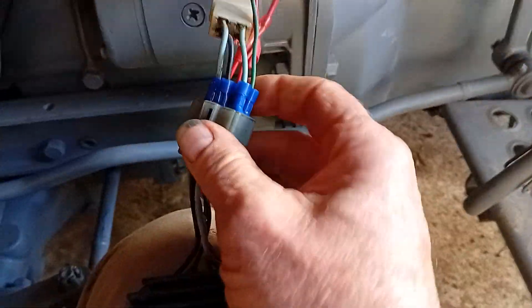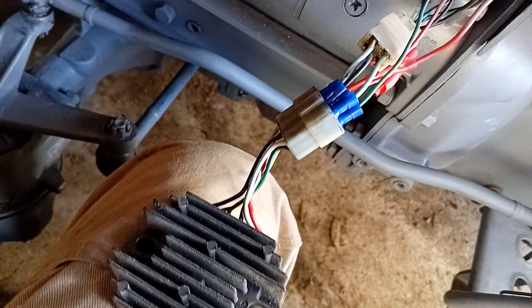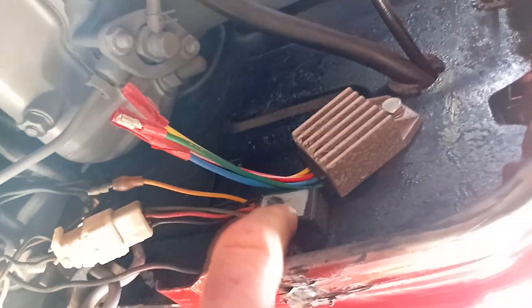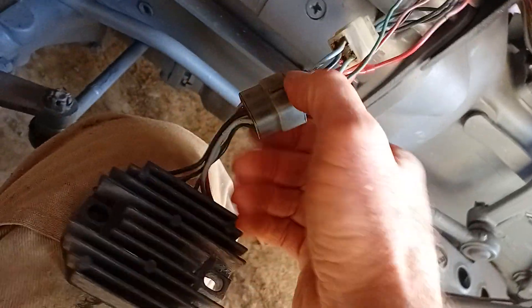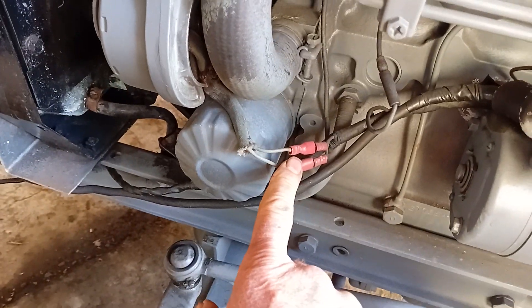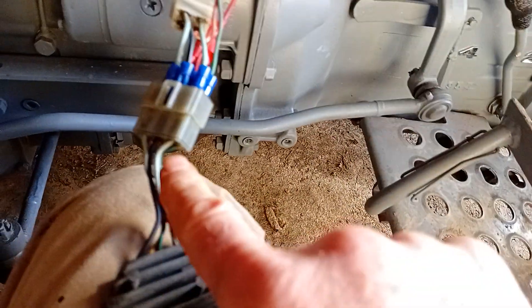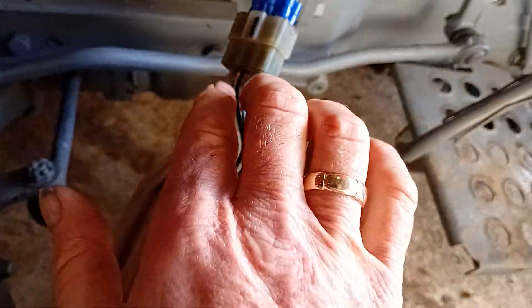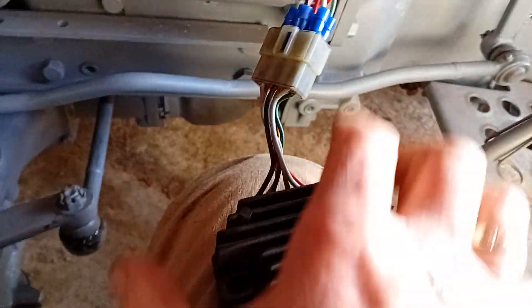Come over to the regulator. I just rewired this one — I took it off a wrecked engine. Come into this side here and touch those wires. Again, check on AC — the two blue wires. If you have AC voltage coming out of the alternator but you don't have it here at the regulator input, then you've got a wiring fault. If you do have voltage on the two blue wires coming in, proceed to the next check.